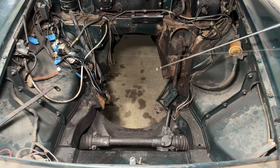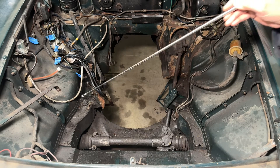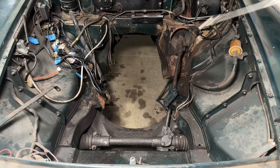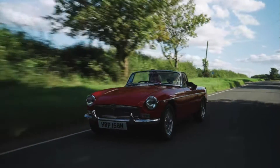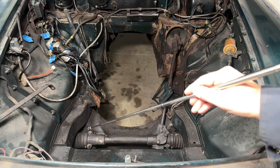What does it look like actually in the car? The first major component is the front suspension cross-member — this big hunk of metal that sits transverse to the car and is attached by four bolts. All of the steering and other suspension components are mounted to it, and we're actually going to drop this entire section when we tear down the front suspension. Let's say it's a sunny day, you got the top down, you're cruising, and you're coming up on a right-hand turn. Turning the steering wheel clockwise rotates the shaft connected to the steering wheel, through a universal joint to the secondary shaft, which then connects to a rack and pinion setup mounted to the suspension cross-member by four bolts.